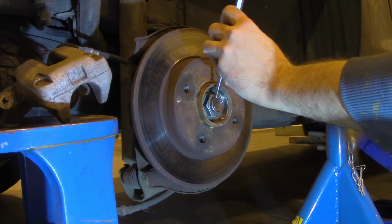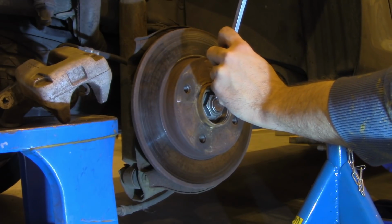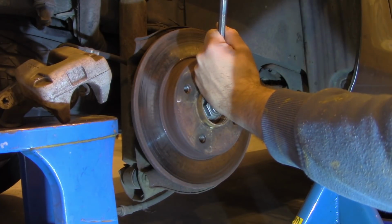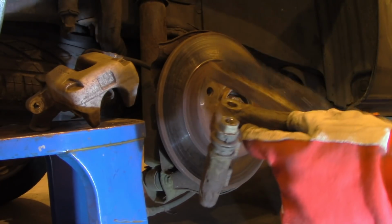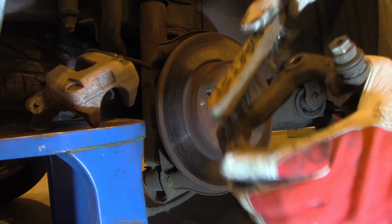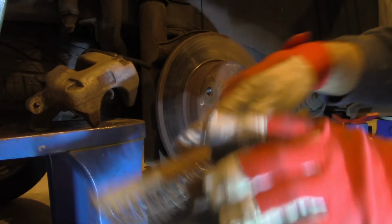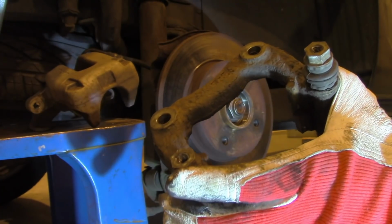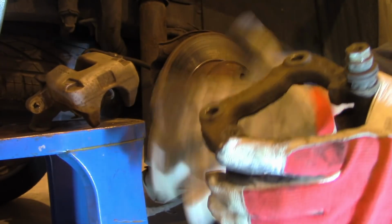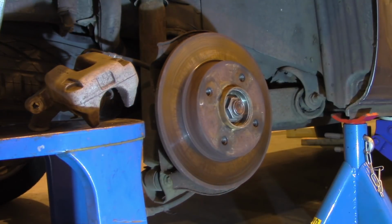And now we need to bend the nut back to prevent untightening. Okay. Now we install the support bracket. Before we do that, we clean the surfaces that are in contact with the surface on the other side. You can clearly see which ones are that. And while you do it, there's so much rust on it that I recommend that you use some mask for your face, not to breathe it into your lungs. Installation is the reverse of removal, so I'll just speed it up for you.